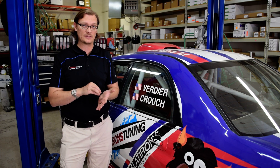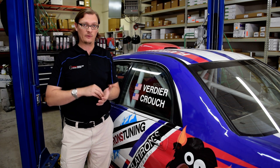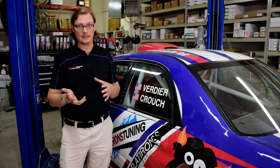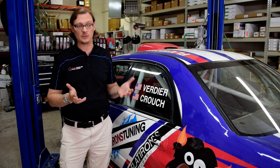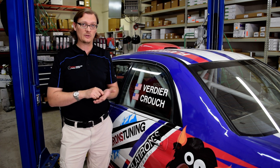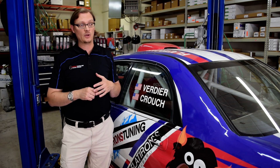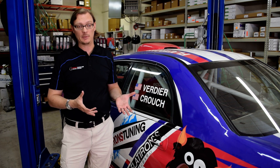It's a lot easier to do the six-speed swap into the GD compared to the GR, unless you have a 2006 or 2007. For the 2006 and 2007 WRX, I'd refer you to our other video about swapping a six speed into the newer GR chassis, the 2008 to 2014. Because the 2006 and 2007 WRXs only have a unique final drive of 3.7, which means there's no six speed that will match up to the R160 rear diff in those cars, so you have to address that. But as far as the axles and everything I'm going to go over, that all applies.